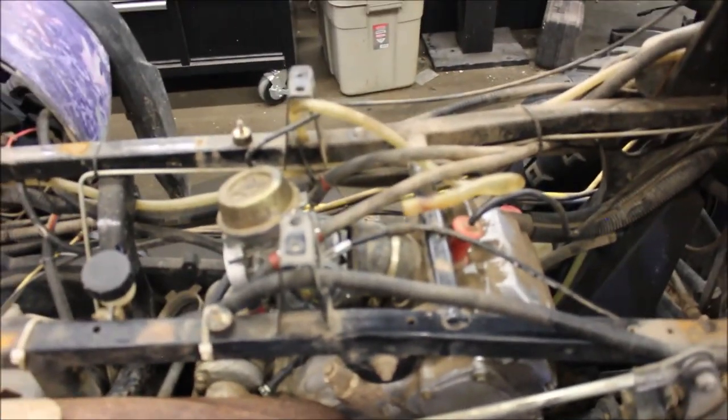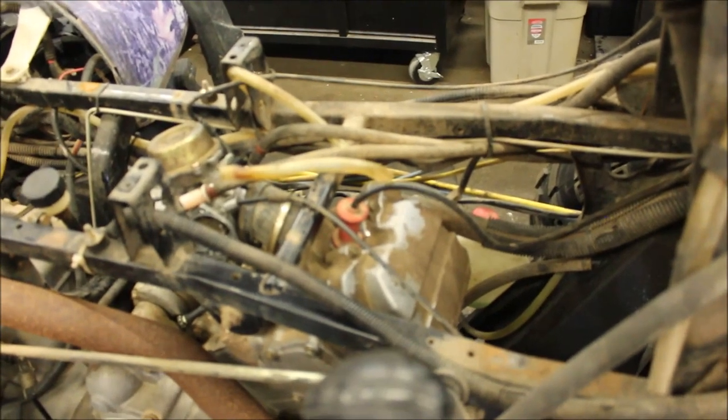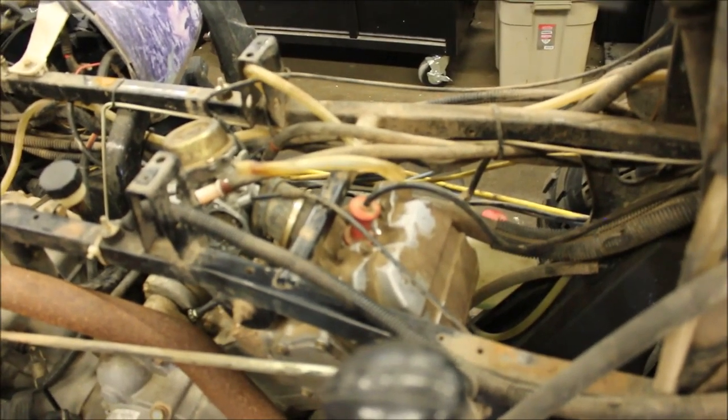Look at that — yeah, that's why it didn't start. That's kind of funny. I'm going to start tearing this thing apart. I think I'll first start with taking the rocker cover off, see what I've got going on, see if this thing turns over freely, and go from there — just start disassembling the engine, take the exhaust off, get that footboard out of the way.